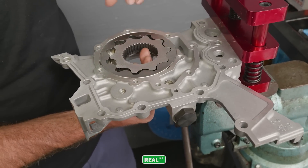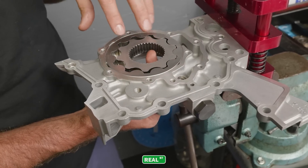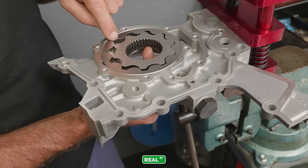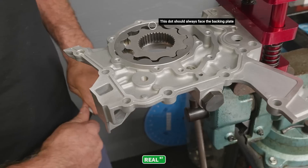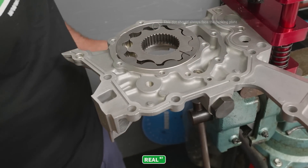It does suffer from high-speed feed. At higher engine speeds these pumps suffer a little bit compared to a gear pump because you can't fill the inlet side of the pump fast enough and it'll start to cavitate. But before you take the pump apart, I would just mark the housing so you're putting it back together in the same orientation.